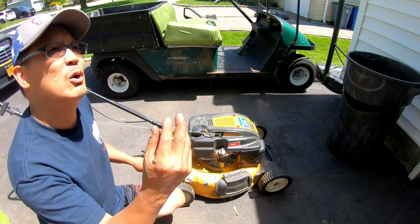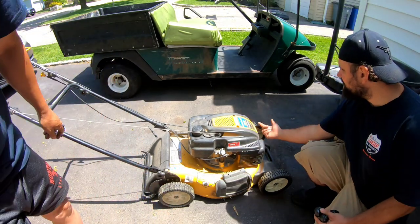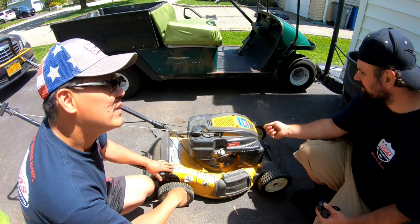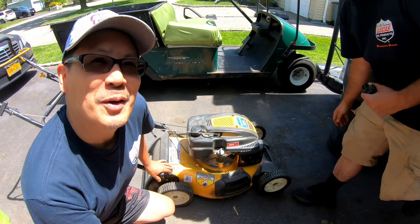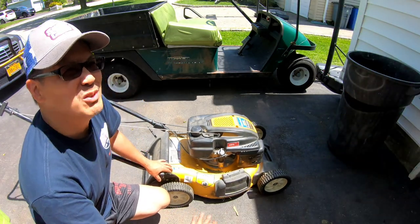I don't even know if there is a jet in the bowl nut. This is like a Honda style carburetor, so the jet is built up inside. So when that thing is clogged, it's clogged good. You need to just run something right up the middle, right up the keister. Call it a day. So it should be an easy job. I'll just do it really quick.